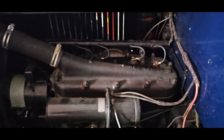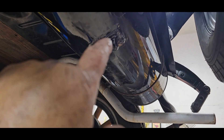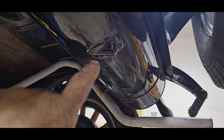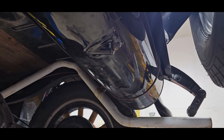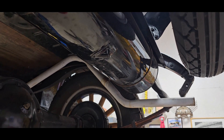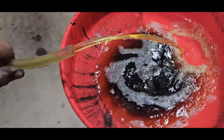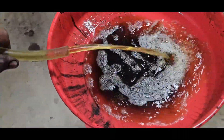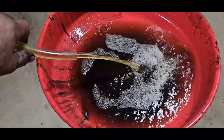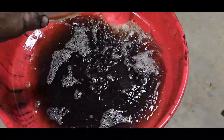I know it's a fuel problem now. This is why you should only use brass plugs in steel fuel tanks - that cast iron plug isn't coming out and I'm not even messing with it. So I guess I'm going to be siphoning fuel the old school way. There's some more of that urine-colored fuel. I've only got a quarter tank so it shouldn't be too bad.